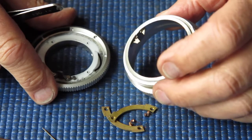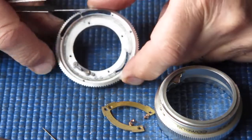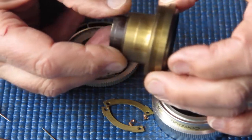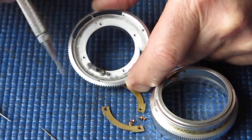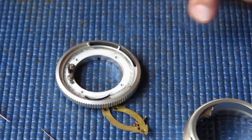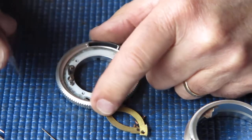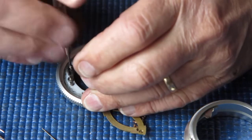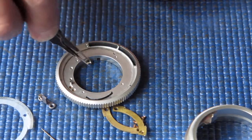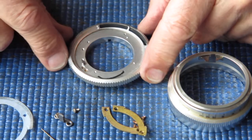So we're just down to the chassis here. This guide post guides the lens capsule - basically stops the inner lens capsule from rotating, so that as the outer helical is rotated it forces the lens capsule to move outwards or inwards, not just rotate. That's effected by this guide post, held down with two large screws. Underneath that post we've got a Teflon washer which I want to get off and clean. Take care with that Teflon washer - it is easily stretched, and if you stretch it it's distorted and it won't lie flat anymore, which would make it not work properly.